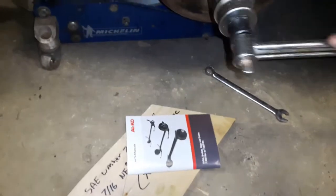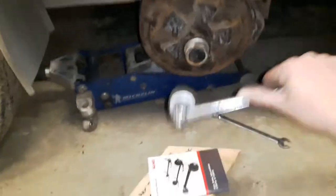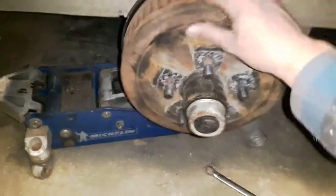The castle nut on this model is 38 millimeters. It gets tightened up to 20 foot-pounds and then backed off to 10. You're supposed to keep the hub turning as you're tightening it. That's basically it for today.